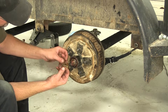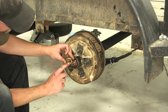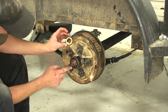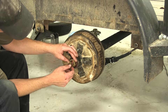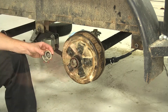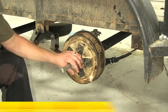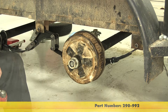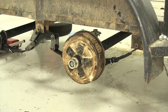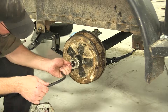Then we'll take the axle nut keeper, which is supplied with the axle — it has a flat tab that points to the inside while the rest go around the outside to lock around the nut, and that flat tab will line up with the flat spot on the axle. Once we have the lock in place, we can go ahead and reinstall our dust cap. We'll be using the Redline dust cap driver, which will help to drive the dust cap in straight. Because we're using our Easy Lube axle application, we'll remove the inner cap and finish greasing up our new axle.